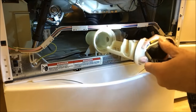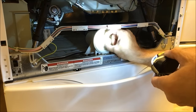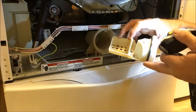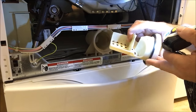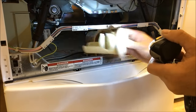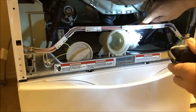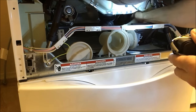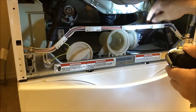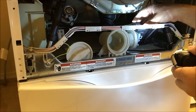This right here is the filter for the drain. You unscrew it and a lot of times you'll find pet fur, loose change, or something caught up in this filter. But this is actually pretty clean, which is a concern to me, because that means the problem is probably the drain pump. The pump takes the water and runs it through this tube that goes up and out into your wall. Because it has to go up and out, it needs this pump to get the water moving.